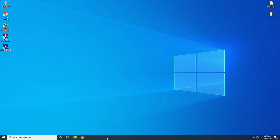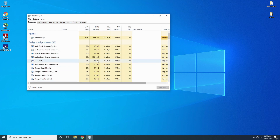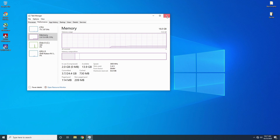Now we're going to open up the Task Manager by right-clicking on the taskbar and selecting Task Manager. Go to your Performance tab, go down to Memory, which is reading 16 gigs. And you can see right here it says 3600 MHz. To test it and make sure it's stable, I'd recommend running something like Prime 95, which tests your CPU and memory both. Or you can run Memtest86 — that's a good program to test stability.